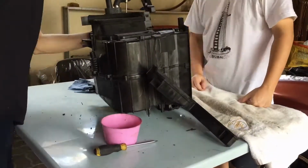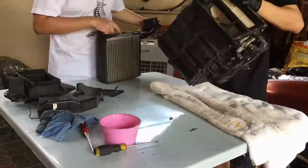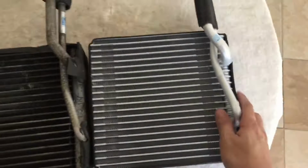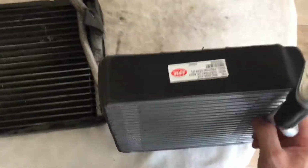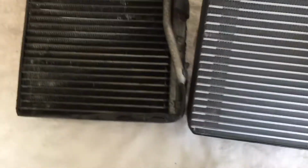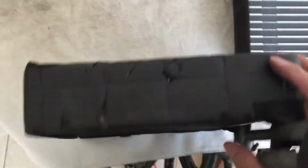In today's video, I will show you how to replace the cooling coil in the Gen 2. How I knew my cooling coil was leaking is that I could smell the R134a refrigerant gas once I turned on the air conditioning. You will need to remove the dashboard completely, which I have covered in my previous video, link in the description.